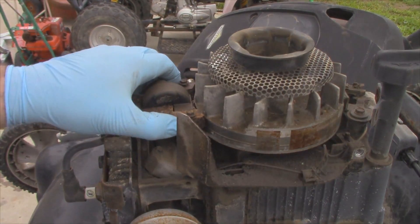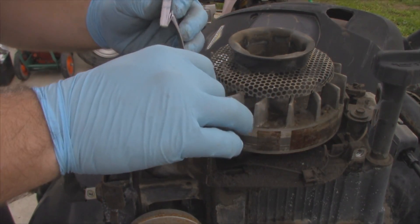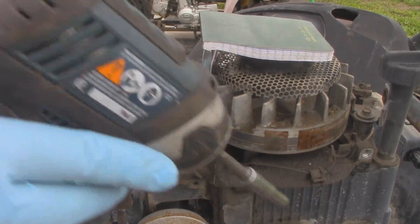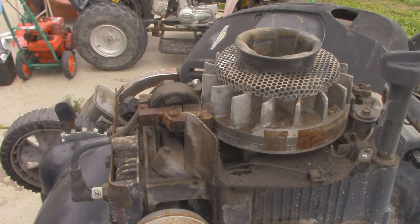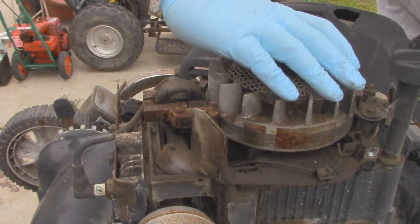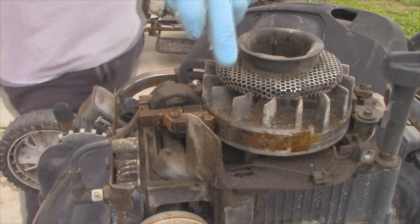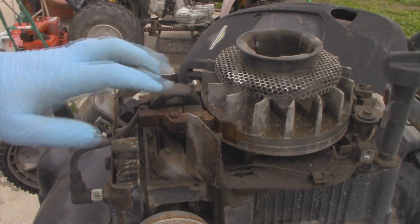I did notice that the coil was a little out of spec, so I undid the two bolts. You can do this with a business card or something like this — it doesn't really matter. So we're just going to align it. It spins nice and freely now. It was contacting the magnet side of the flywheel on both sides, but now it isn't, and it's got a nice healthy gap in between.